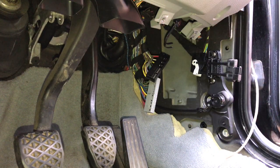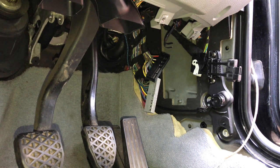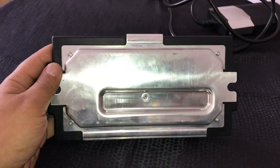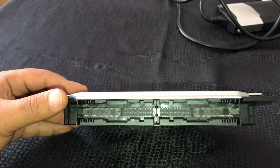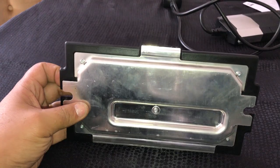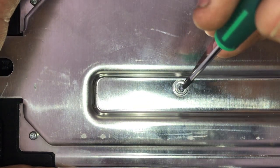So what I'm going to do now is check every single wire from that plug. And if there's no problem there, we're going to have to look at this module. So I've got the module here - it seems pretty simple to open up, got five Torx screws at the back. I've checked all the connections here, it seems to be in good shape - no bent pins or signs of rust. I checked all the wiring and all the wiring seems to check out.